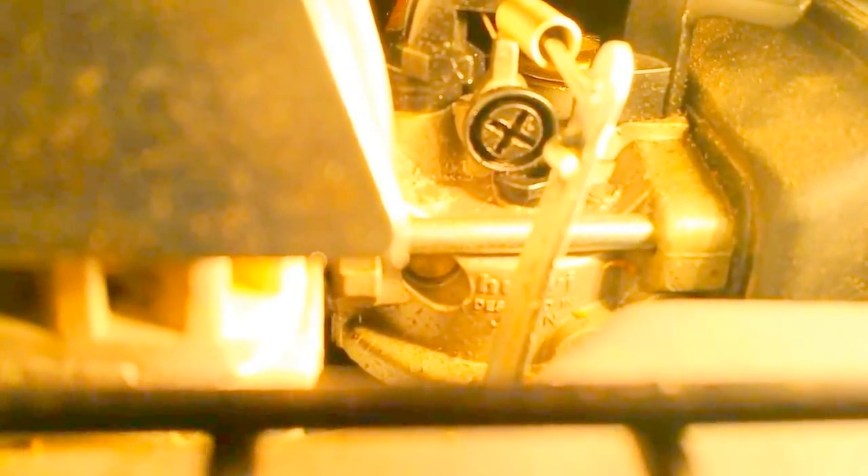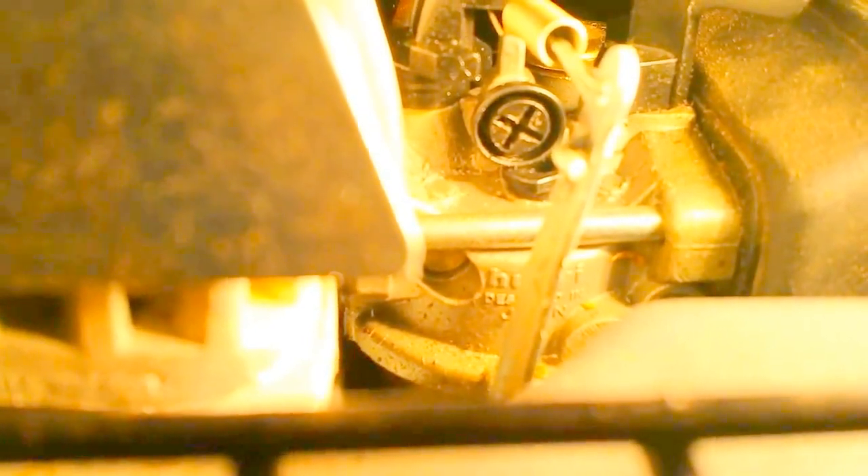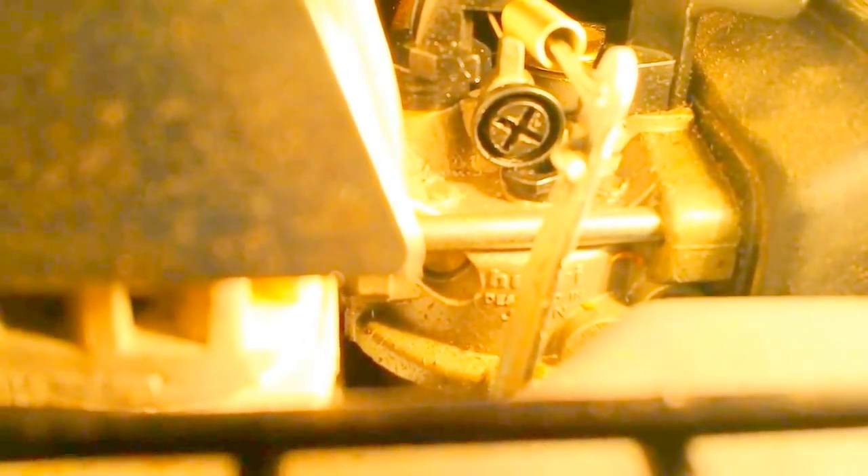Go ahead and pull the screw out when you're cleaning it. If you don't take those little plastic plugs out — they're hidden — and what it is, is in order to be air quality or California compliant, they adjust the bike to run real lean and then they put a plug over that adjustment screw so you can't touch it. But when it comes time to clean it, you're going to clean it and not figure out why it's still running bad.